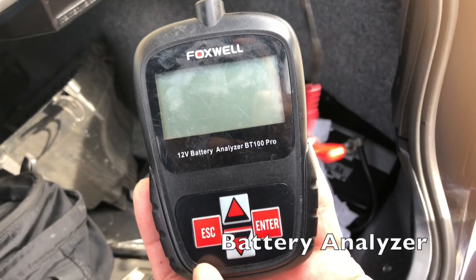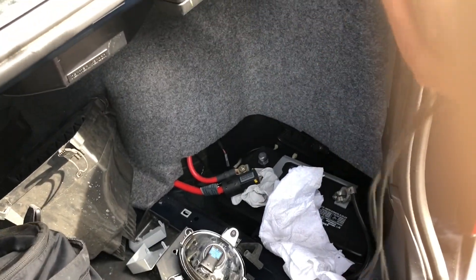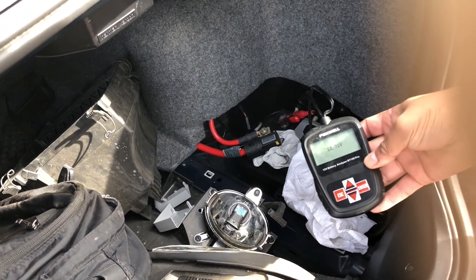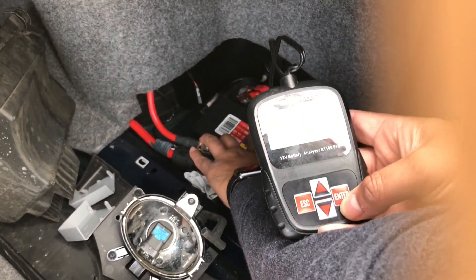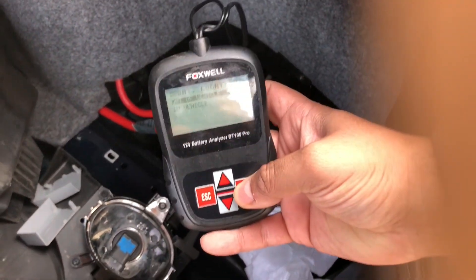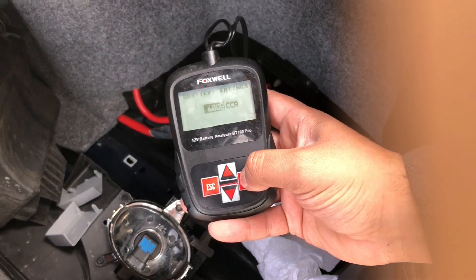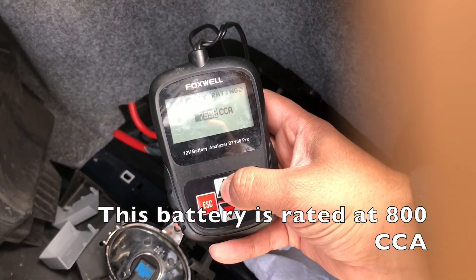I actually did this at the store — I took the tool with me. As soon as I got into Walmart, I told the associate this was my tool, and she gave me a little sticker to prove it. I hooked it up on the battery at Walmart and tested it. You want the voltage to be anywhere from 12.2 to 12.8 — anything less than that is not a good battery. This battery analyzer checks that it's at a hundred percent or close to it. I've bought batteries before from Walmart and other places that were completely dead when I got home, so I always take this analyzer to make sure the battery is good and I don't have to make another trip.